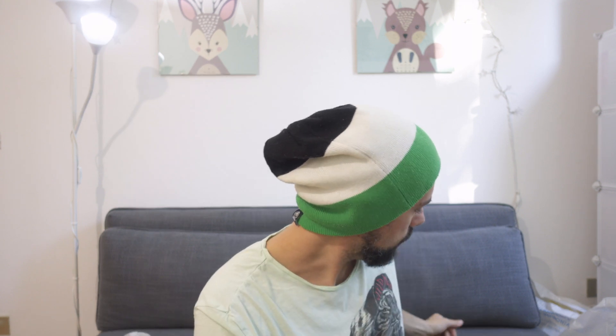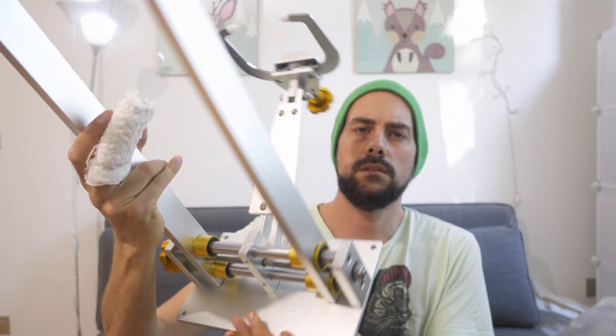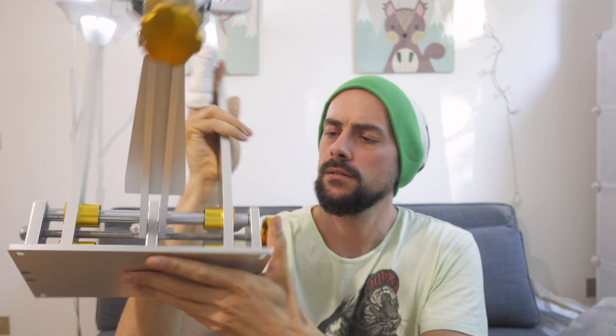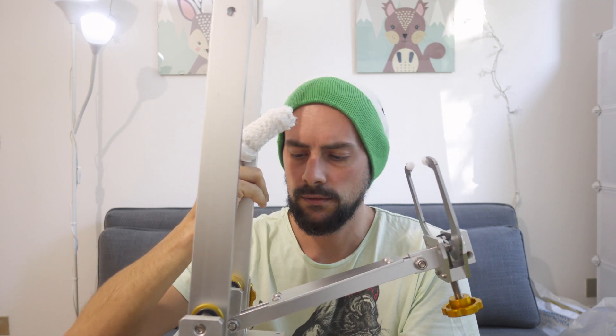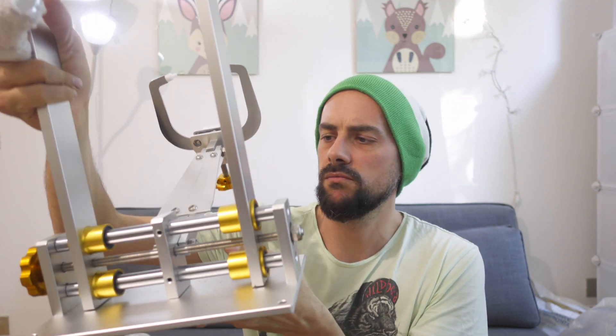Some kind of lube just to lubricate the nipples and the threads of the spoke. I have this CTTO tension checker from AliExpress — it's not essential, but you need this tool to check, toward the end of your build, if the tension of the spokes is even all around. Of course, you also need a truing stand. I bought this from AliExpress, I've already tested it and it does the job.